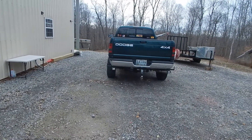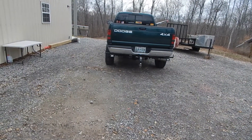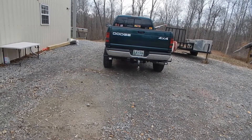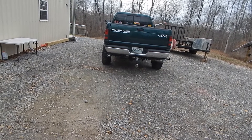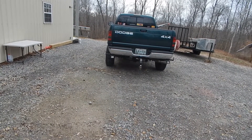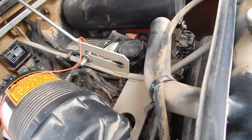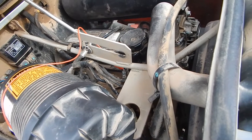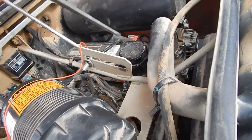My Dodge over here has the 6BT Cummins — that's got a mechanical fuel injection pump, no computers on that truck at all. It's all old school mechanical. You run that out of fuel, you're having a bad day. You've got to crack the injectors, bleed the fluid out of it, get the diesel fuel coming back through the system, tighten it down, and eventually it'll start. Anyway, that Cummins engine does not have glow plugs. It's a direct injection; it uses a heater grid — which is a whole other story we're not going to get into.